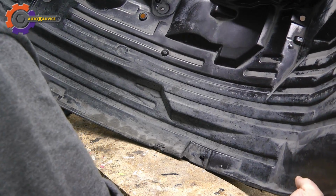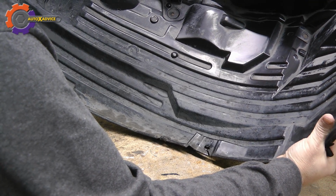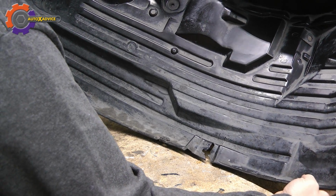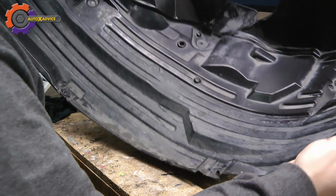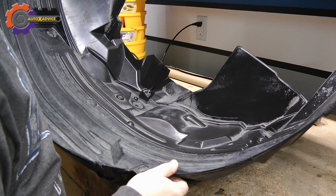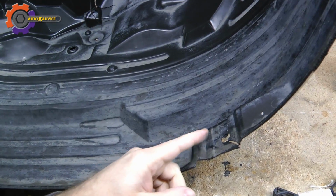So now, as you can see, there's a hole there, and it lessens the stress a little bit. I don't have to have much force when I pull these together. However, right now I have to figure out a way to bring these two pieces together so that I can weld them. And the way that I'm going to do that is putting some string to tie these two ends together so that I can bring this piece together so I don't have to hold it. And I think that's going to work out with that crack closing up quite a bit.